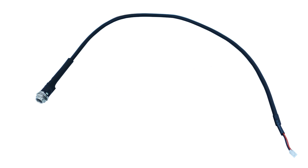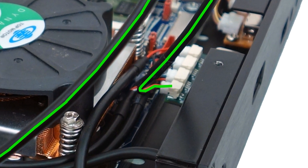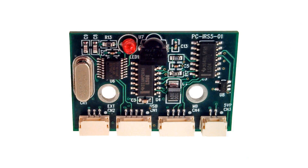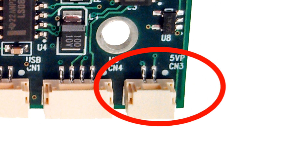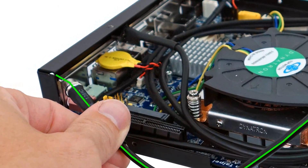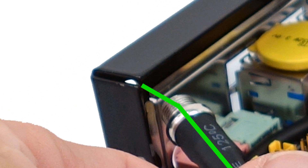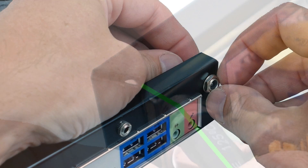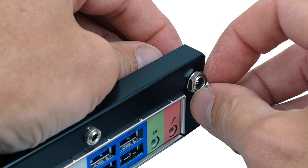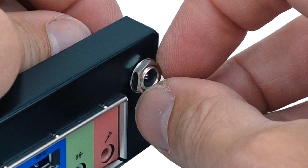Find the IRS-5's internal power adapter cable. Connect the IRS-5 connector end of the internal power adapter cable to the IRS-5's 5VP CN-3 connector. Locate the 3/8-inch hole on the back of the Inteset Thin Mini ITX case. If you're not using Inteset's Thin Mini ITX case, you must either find a similar hole or drill a 3/8-inch hole in the back of your case. Insert the 3/8-inch jack end of the internal power adapter cable into the case's hole and screw on the fastening nut.